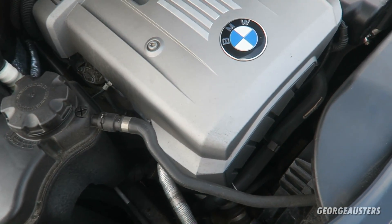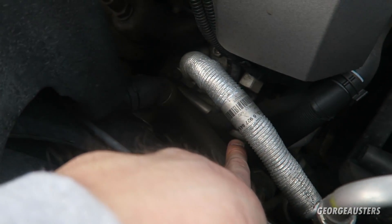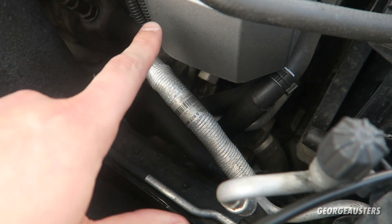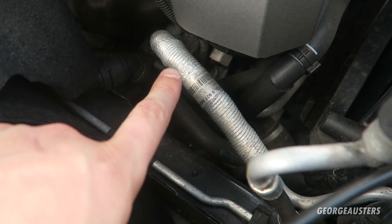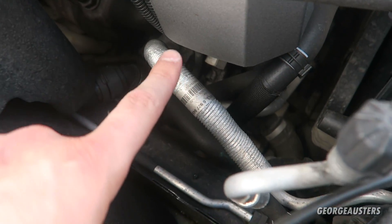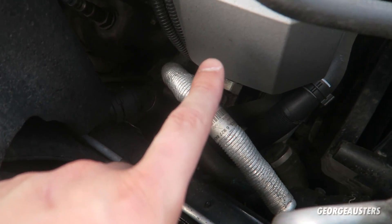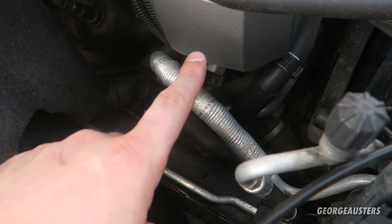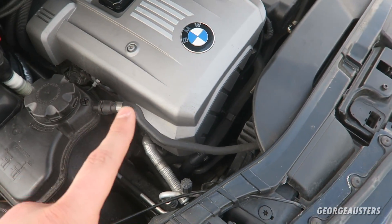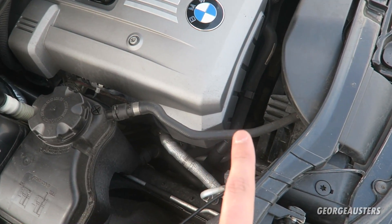Let's start with the first part: the water pump. On these N52 engines they have an electric water pump, which is located right down there at the bottom. These water pumps will more than likely fail before 100,000 miles, so if your car has reached that and there's no history of it being replaced, go ahead and replace it. When replacing it, it is very important to fill the new water pump up with fresh coolant — if you run the engine without coolant in the water pump you risk burning it out.